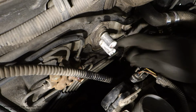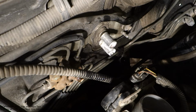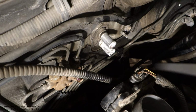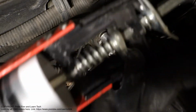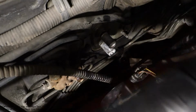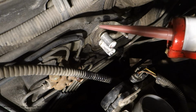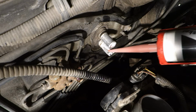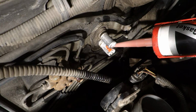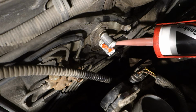Next I am planning to apply this glue in there, and then I insert my hose and these clamps. And next we continue. Okay, here I have my compression machine, that when I pull the trigger of this pistol, I press that, and the glue comes out of this nose. Okay, and then I start applying it. There is this red glue, and I apply it now in this outer area, all areas in here in that way, and the purpose is to stop those coolant leaks.